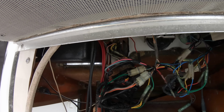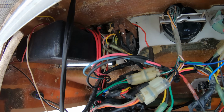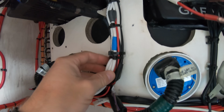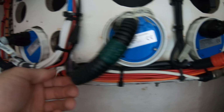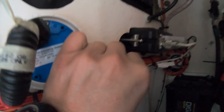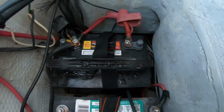If we see that all of the wires are just hanging around, you'll probably end up going through that mess to figure out how to make all the lights and pumps operate when you want them to. If you see that most of the wires and connectors have what is called tension relief close to the connection, this is a good sign that the wiring has been installed properly and that someone hasn't been in there messing with it. Take a look at the batteries while doing the inspection of the wiring and bilge.